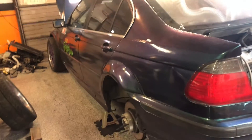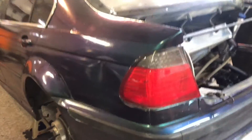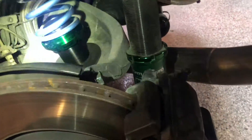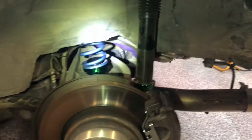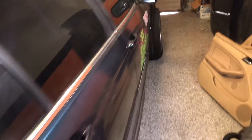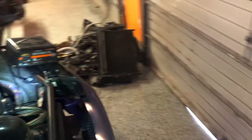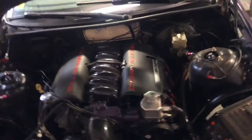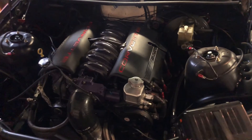Now I'm going to set the preload and get the shocks reattached. I forgot my coilover adjuster spanners at the shop so I can't adjust it much. Five millimeters of preload on the inside of the spring is leaving almost a finger-sized gap on the outside, so I'm going to jack it up until the whole spring contacts and then reset the shock droop. The battery died as I mentioned earlier, so I've got it on the charger rigged up to the kill switch and chassis ground — the battery's in a sealed box so I don't want to take it out. I'll let it hang out for about an hour, start her up, run her through a heat cycle, make sure everything's good to go, and call it a day.